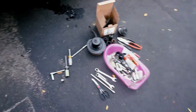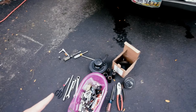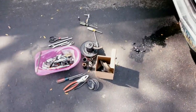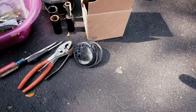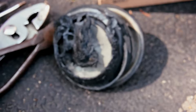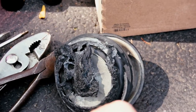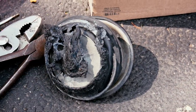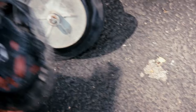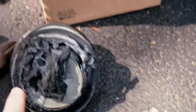The parts he was removing earlier are mostly the blower fan. The bearings in the blower fan were basically shot, so he ordered a brand new blower fan to install. When taking that apart, we discovered there was some — as he calls it — a thermal event that caused this to melt. This is the vacuum actuator; this is what controls when you flip the switch from outside air to inside air, or heat to cold. You have to have a good vacuum seal, and obviously something with the hole melted completely in it doesn't seal particularly well. So we're going to need a new one of those.